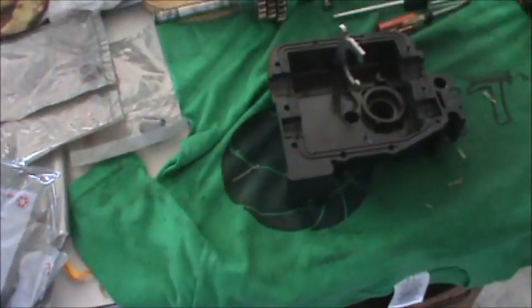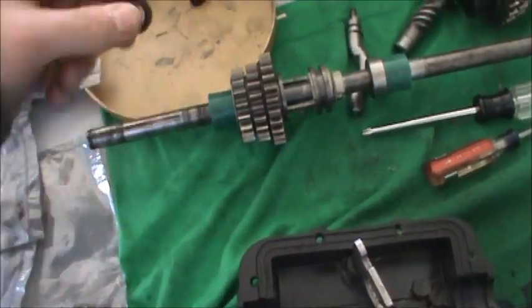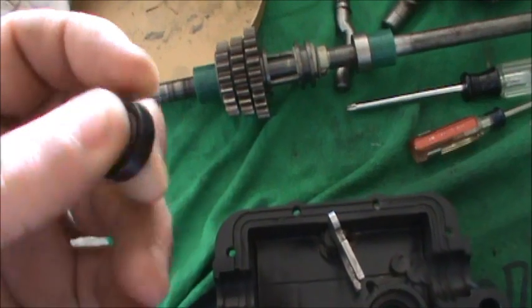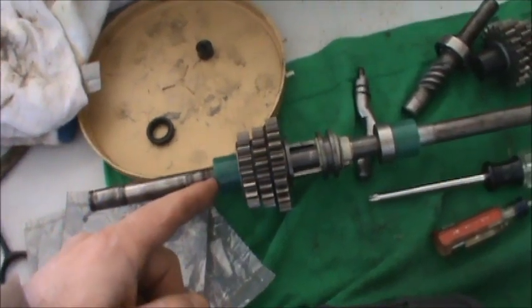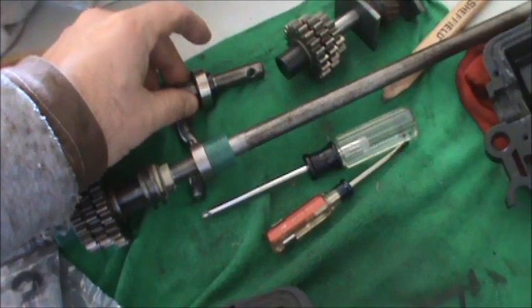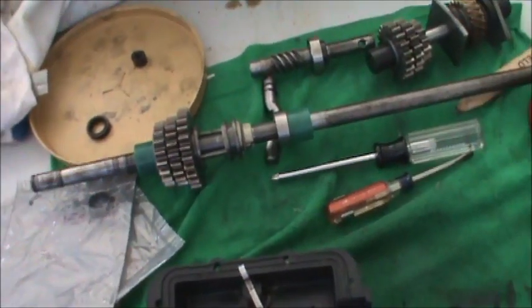It's about 10 days later. I ordered a bunch of Honda seals and bushings, but these did not fit — they fit the shaft but didn't fit the outside of the green bushings. After I pulled out the original oil seals, they had metric numbers on them and I was able to get the right size: 12.5 by 19 by 5 millimeter oil seals. I ended up getting three of them, which I found on eBay. Now we'll show how to put this thing back together.